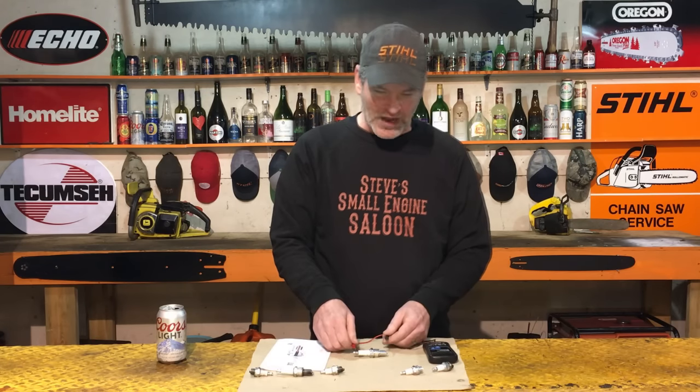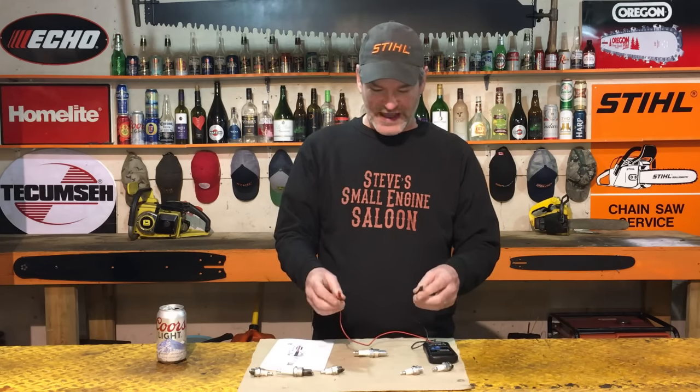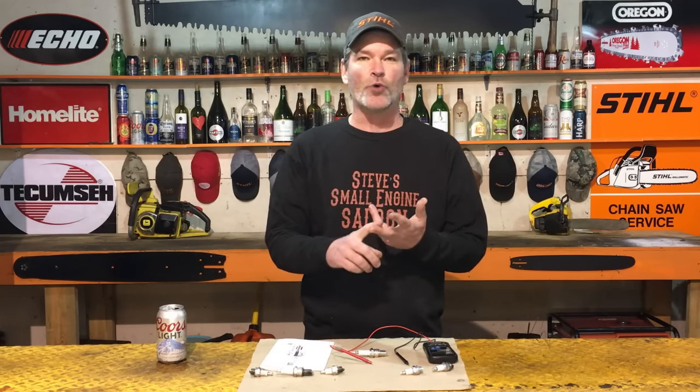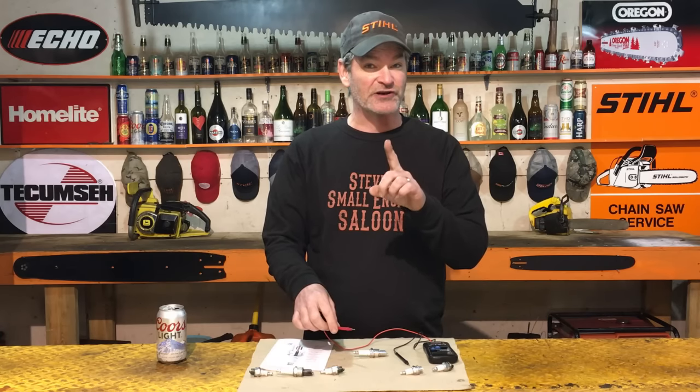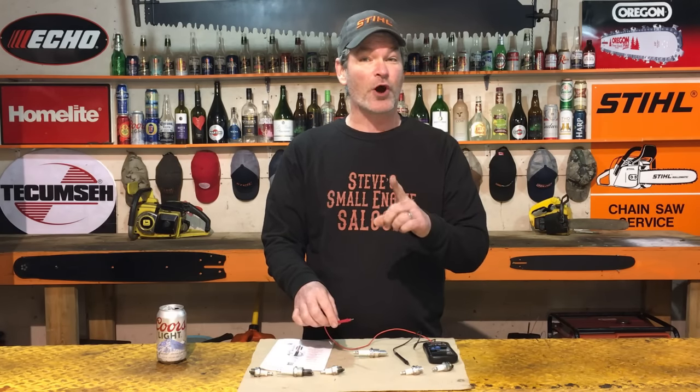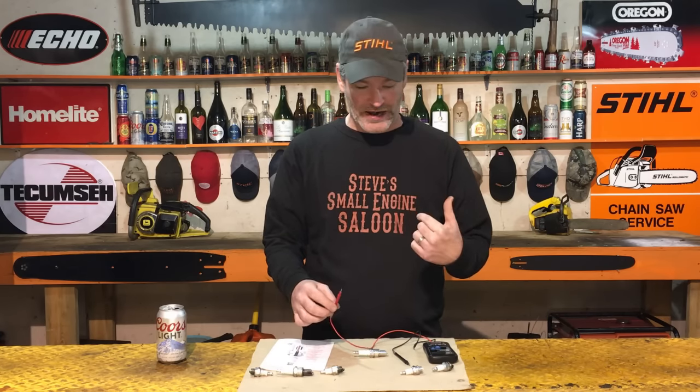I know that there's a lot of videos out there where guys will say on a resistor spark plug, it needs to be between 4,000 and 6,000 ohms of resistance. If it's past 6,000, then your spark plug's garbage. I gotta disagree with that. In the small engine industry, that might be true in the automotive industry, but I'm not a car guy.